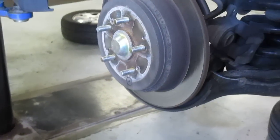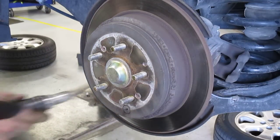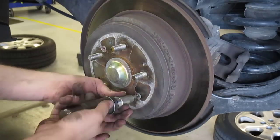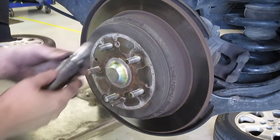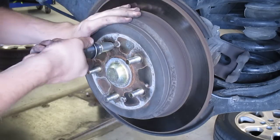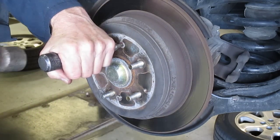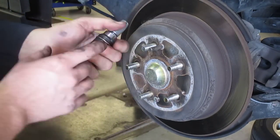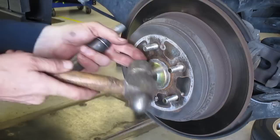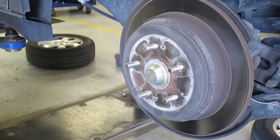Set it aside. Now let's take off the rotor and expose the parking brake. Get the impact driver — it's not going to come off yet. The Japanese folks like these little screws; the American folks use Tinnerman nuts. Get your hammer — this makes it easy. Impact driver, go ahead, spin out the screws to expose the parking brake underneath.